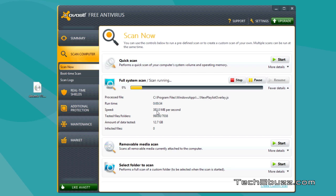These are realistic speeds you can get with this SSD. The speed will vary depending on the file — for large sequential files you'll get good read speeds in the range of about 460 to 480 MB/s, but for smaller files the throughput will fall. The throughput also increases for compressible files because of the SandForce controller.